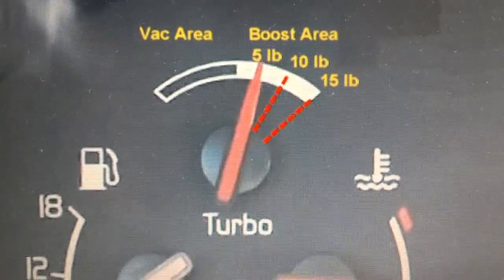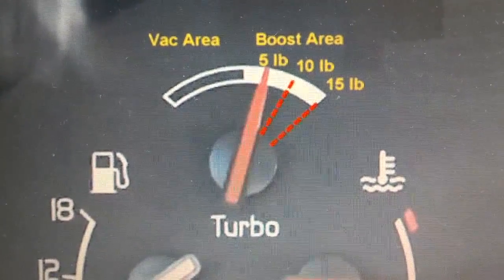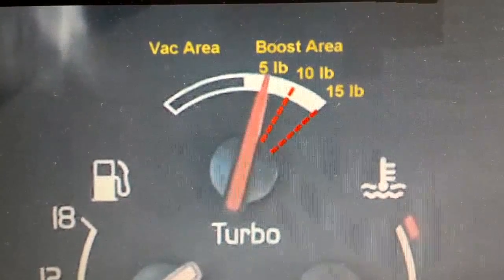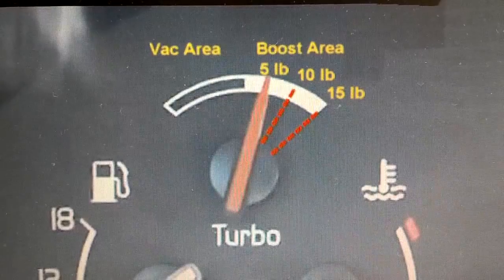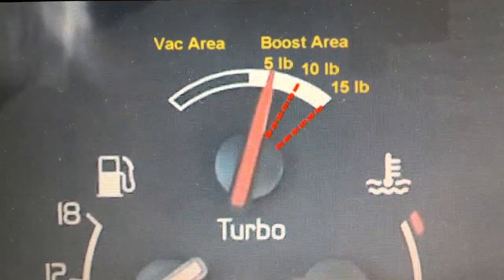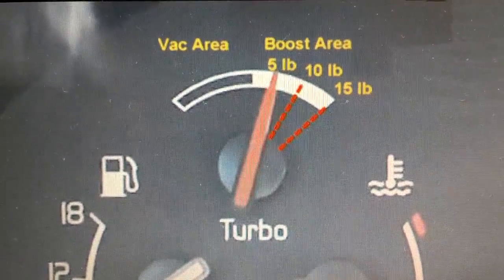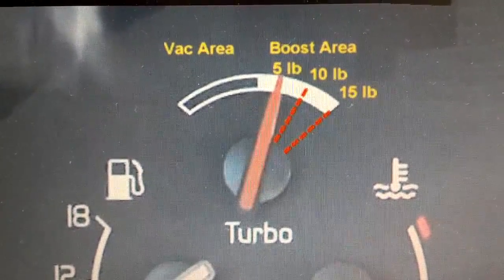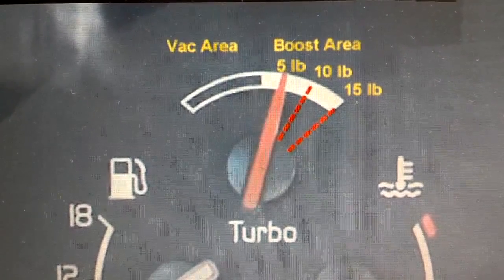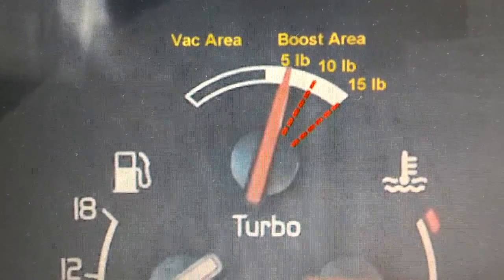On the Volvo 850s, I've talked to a lot of people that have various setups of boosting and have boost gauges hooked up separately from their built-in boost gauge. From talking to them and getting several feedback, it appears that these boost gauges that are built in on the 850s display boost in this kind of fashion. A third of the way is about five pounds, two-thirds is about 10 psi, and all the way to the edge of the white area to the right is about 15 pounds of boost. So when you're driving your 850 and you put your foot in it and your turbo spools up, you should be getting these kinds of boost readings.